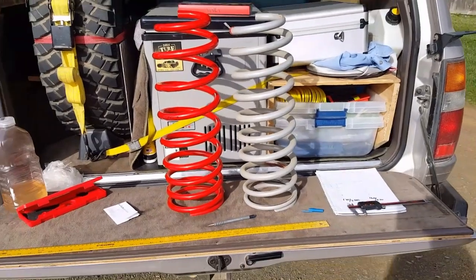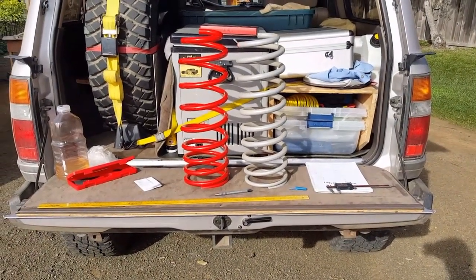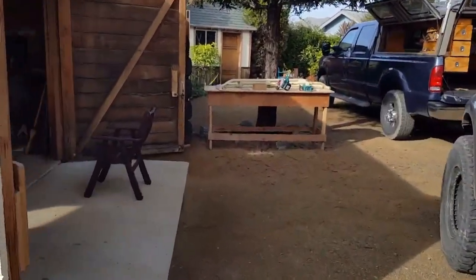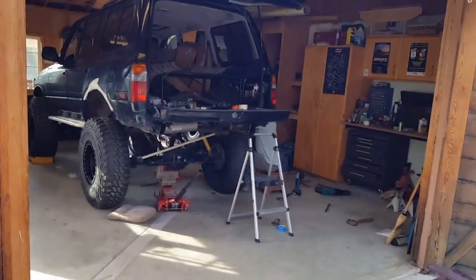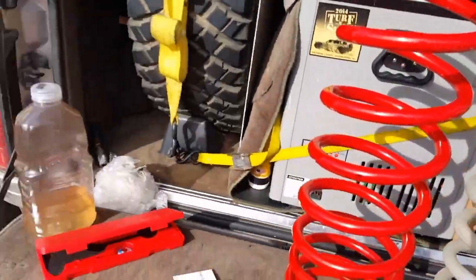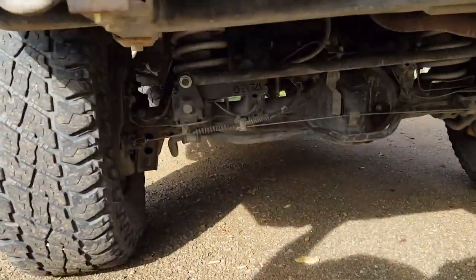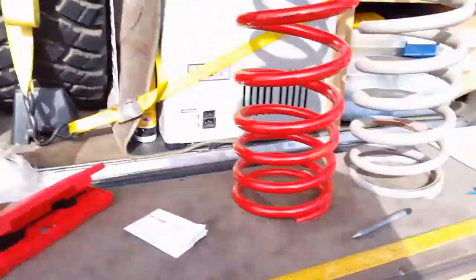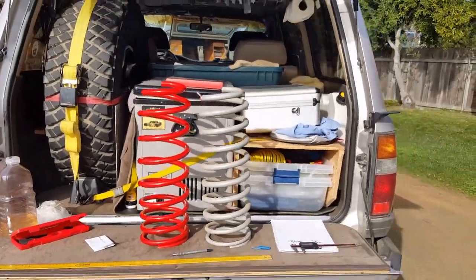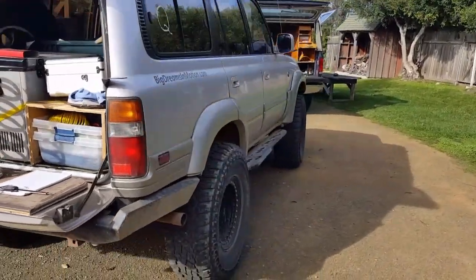All right, so about the only thing left we need to do is get a fender to center hub measurement. But since we're cutting, we're gonna get a frame bump stop measurement. Okay, from frame to the axle, the stock is approximately 4.09 inches. 4.09. All right. Having fun with the LX. And I'm out. I'll get you guys some more information.